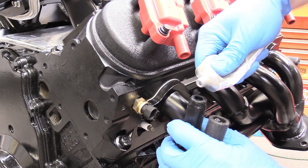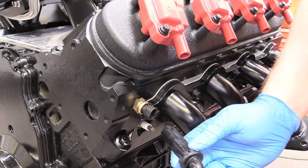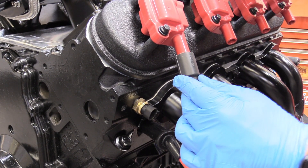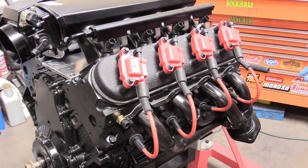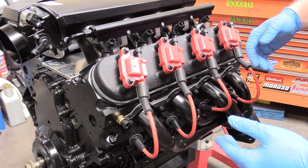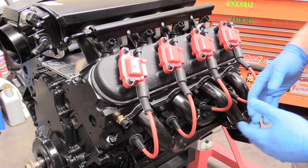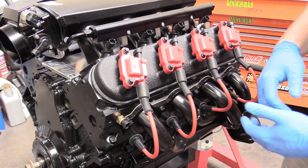Take some dielectric grease and squeeze some into both ends of our connectors. Then put it on the plug first — you can feel it kind of click into place. Made in USA spark plug wires. Then put it on the ignition coil side. Looks fantastic. With all lights on, the main thing you want to make sure is that you don't bend the boot while putting it on — you don't want to crack that porcelain. Make sure these boots have a little bit of room and don't touch the header because they'll melt and then you'll get a misfire. Also, because you're pushing these on and compressing air, they like to pop back off, so go around and check them again and then check them in about a day or so.